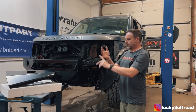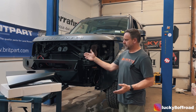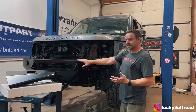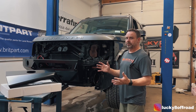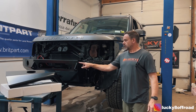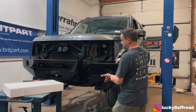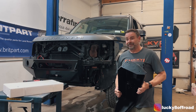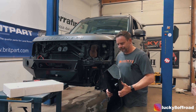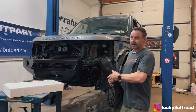Time to do a recap: we've got the winch installed and tightened down 100%, zip-tied wires out of the way so they're not going to chafe on the radiator or the frame. We've got the winch center section bolted firmly to the frame — all eight bolts in and tight. Now we're moving on to the wing. The wing is held down with three bolts — two up top and one on the bottom. If you have a friend, this is another good time for them to be over. I'm going to do this in struggle form — it can be done with one person, but you're not going to be happy.